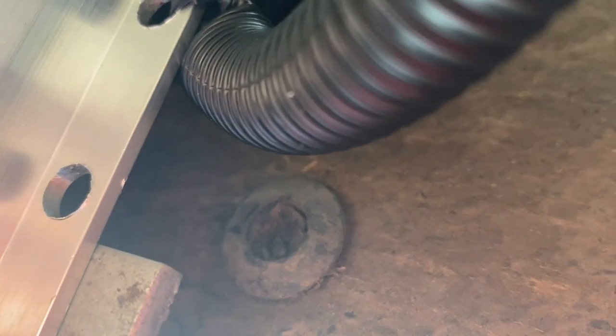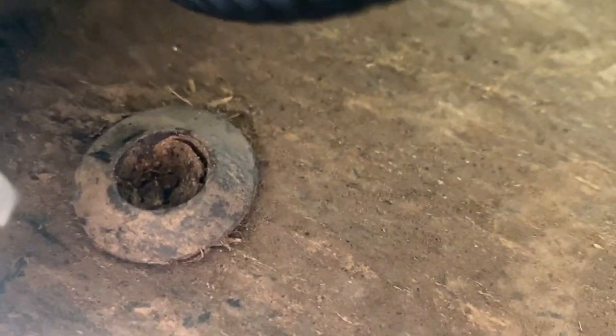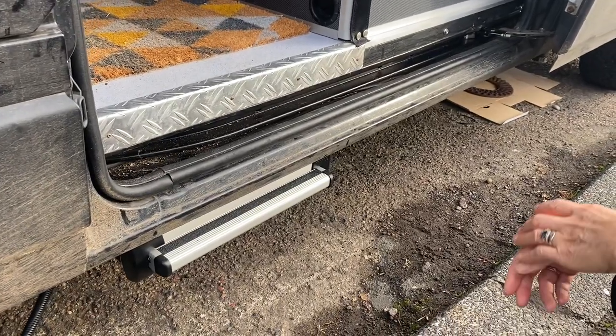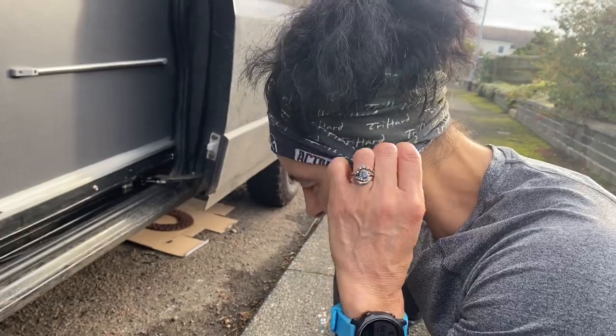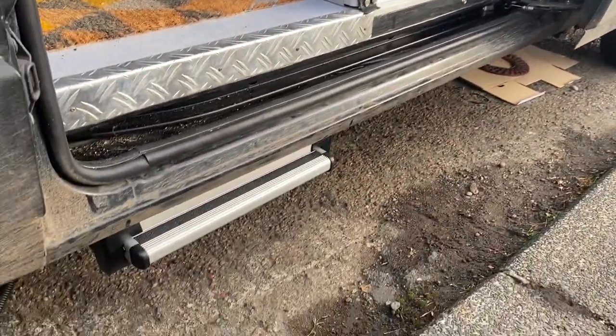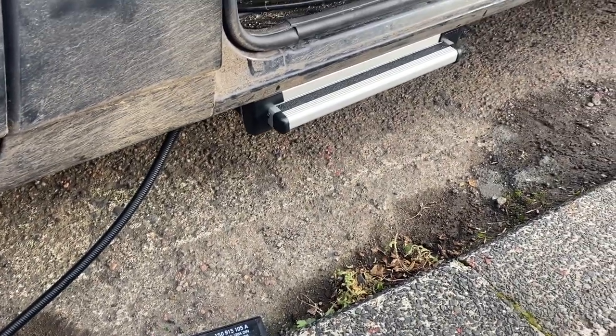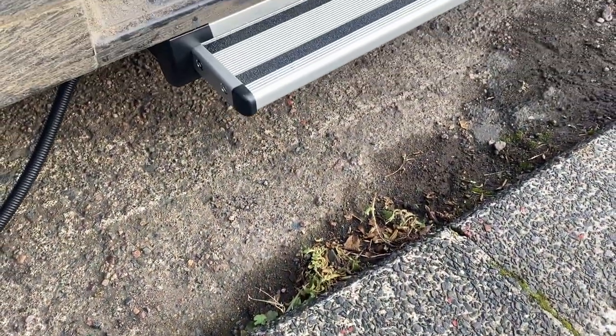This is bolted tight up against the sill. On the Citroen Relay, Ducato, Boxer, et cetera, there's a very convenient grommet in the sill, so I should be able to route the cable up through there to the fuel filler and mount the switch on the door post. Now I've got the step mounted, my beautiful assistant has come out to demonstrate it. I'll rig it up on a battery before wiring the switch — orange on the negative, purple on the positive — and out it comes.